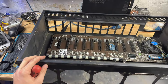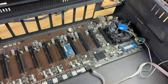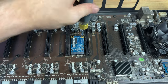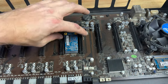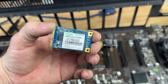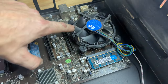All right, all the fans are out. Next up is yanking the MSATA. So we gotta flash that. These do usually still have a HiveOS installation on them. And in fact, I should try just writing a new config to it. That might work, but I don't really want it mining to BitCap, so that's got to come out. Oops. Butterfingers, 64 gig. Onda. No, man, even original to the motherboard. Look at that. So I guess we'll flash that out real quick.